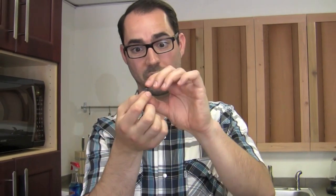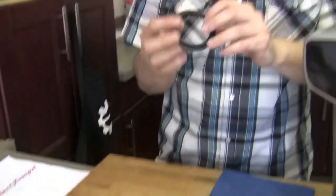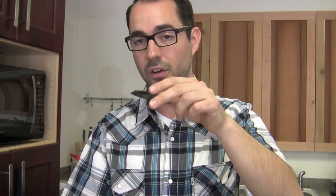If your machine's heating up and you're noticing it's dripping more than it used to — when it's heating up to steam temperature, if it drips a couple of times that's fine, that's normal. But if you're noticing continuous dripping while it's heating up to temperature, it's because the spring is in the process of failing and getting really weak. It can't hold the pressure anymore.